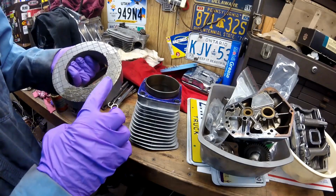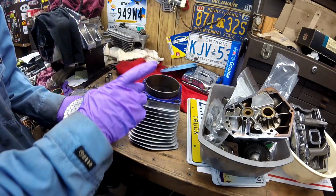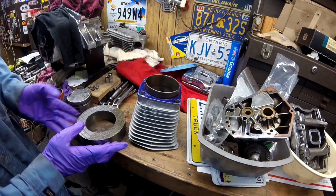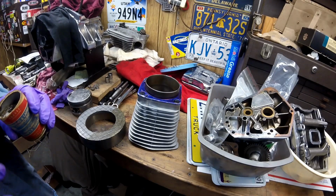You take this Trock Block and you put lapping compound on it, and then we're going to put it on here, and you put machinist dye on the base gasket surface, and you can see the high and low spots and if you're going to need to have them machined or not.